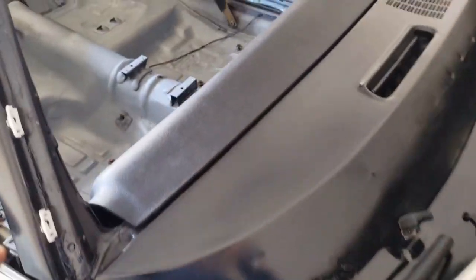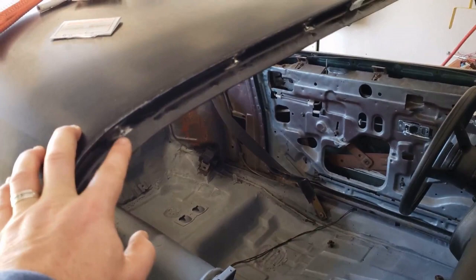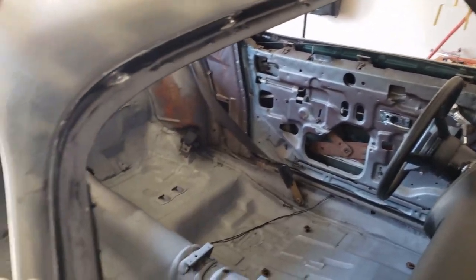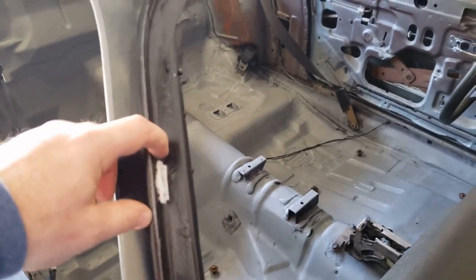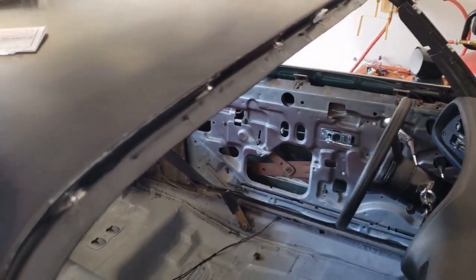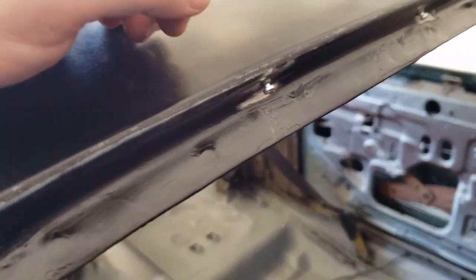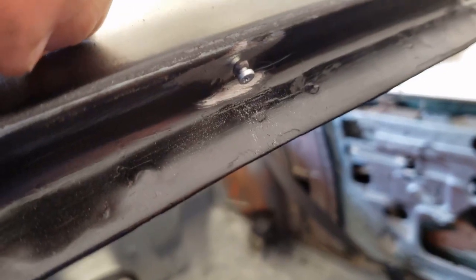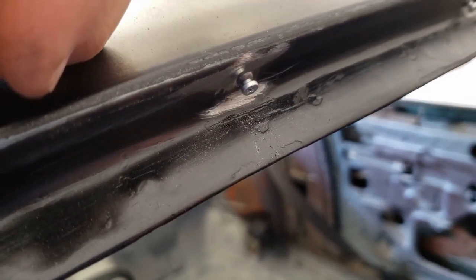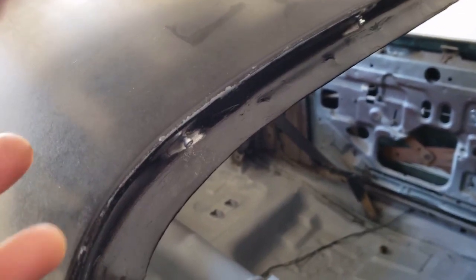Today I'm trying to get the rest of my windshield molding clips put in. While taking the windshield out, I ended up busting a couple of the little studs that are tack welded on from the factory — you can never really get a good weld behind them because they're so tiny. I went to Southern Camaro Firebird dot com and got these little screws. You just grind the old stud flat, drill it out, and screw these in — obviously drill a pilot hole first.